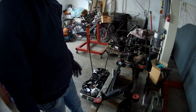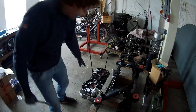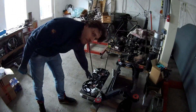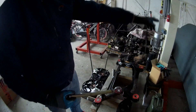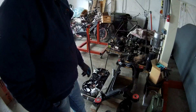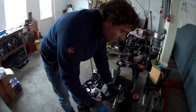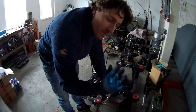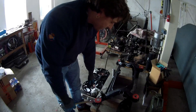The bottom one is just off — a lot. That's three centimeters different from the other ones. But I also did the other modifications on the other car and the alignment is pretty good. The biggest thing most people will modify is the top arm — they want it longer so the wheel sits straight and not inwards. That's most of the modifications.